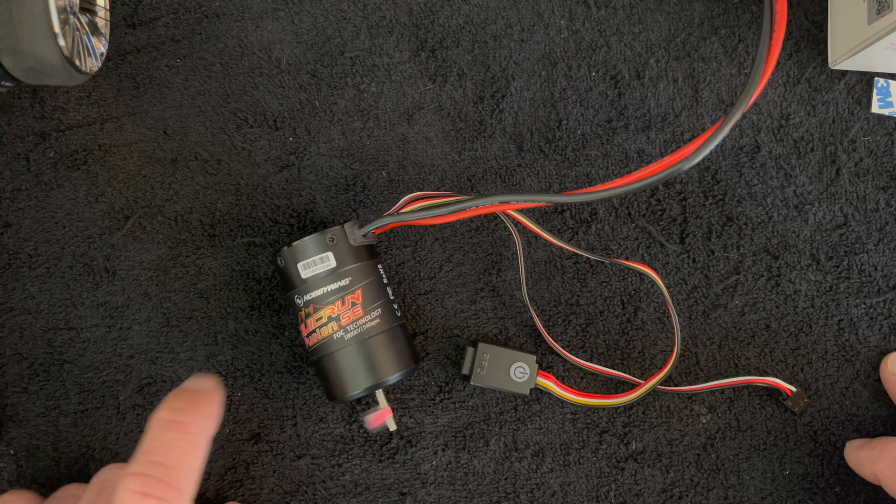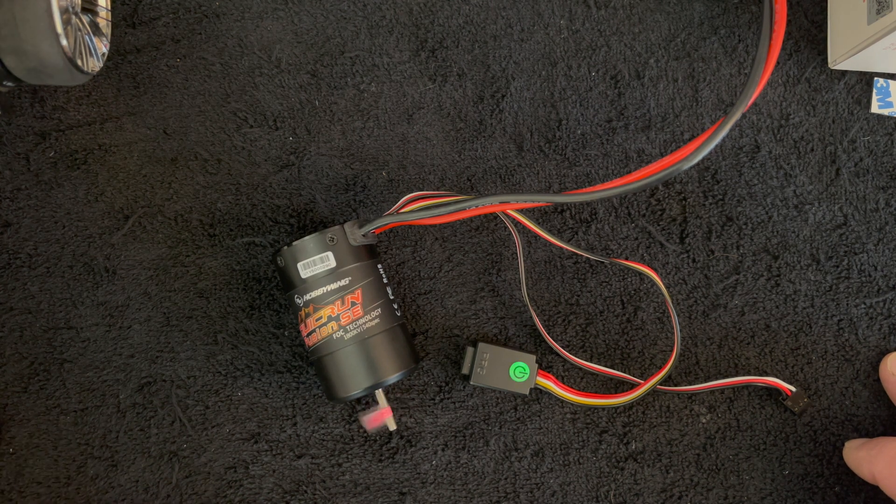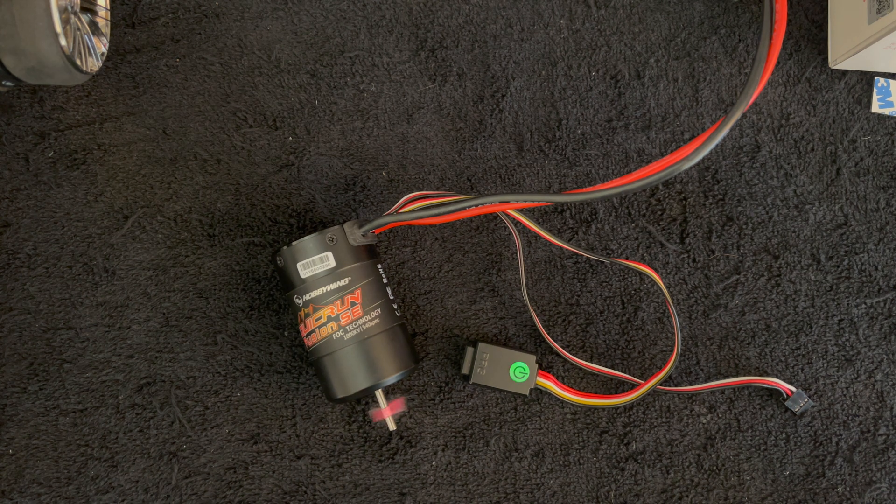You can see it runs at a couple of different speeds. This is why you want to have it disconnected from your drivetrain, because if you have a pinion gear installed or hooked up to the vehicle, it's going to drive the wheels and that affects the calibration process.